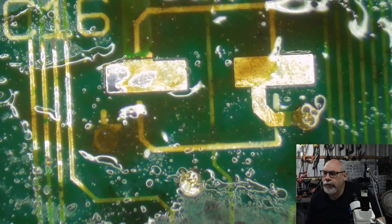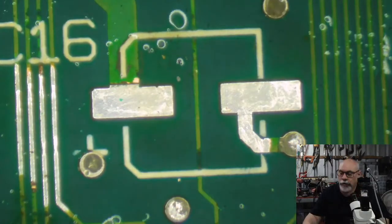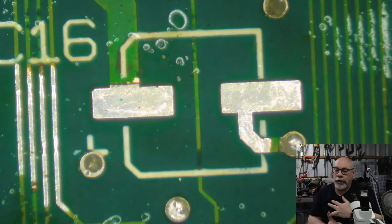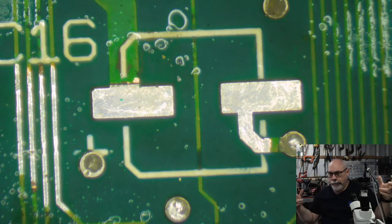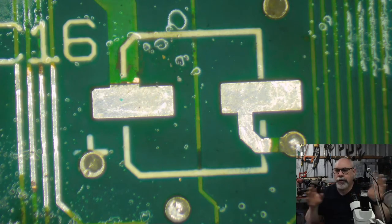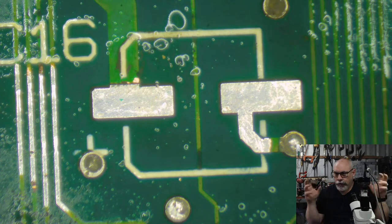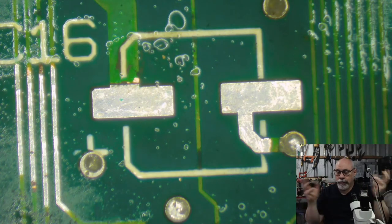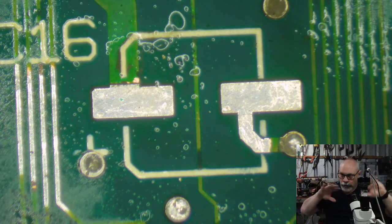Sound is not working. Believe it's because of what you mentioned. Is that repairable, the sound chip? Well, if it is just either broken traces or electrolyte, first of all, it has to be recapped. If it hasn't been recapped, it has to be recapped first, because there are electrolytic capacitors that fail around the sound chip, that if they fail, you won't get sound. So that's the first thing, recap.